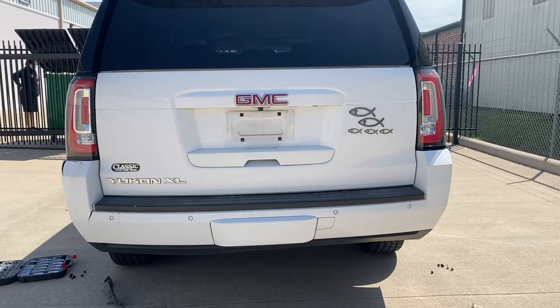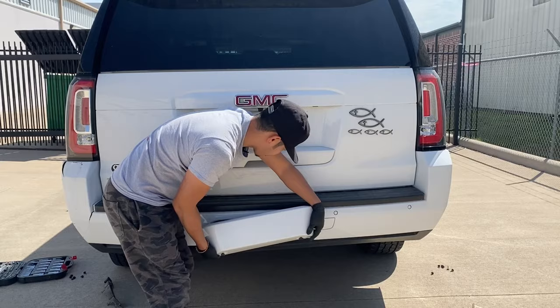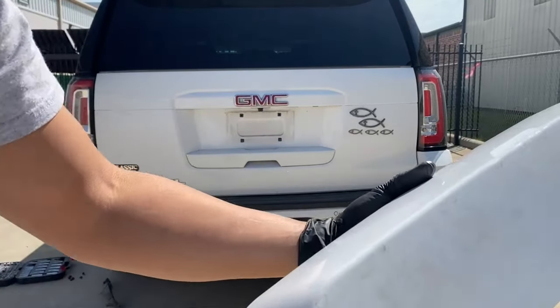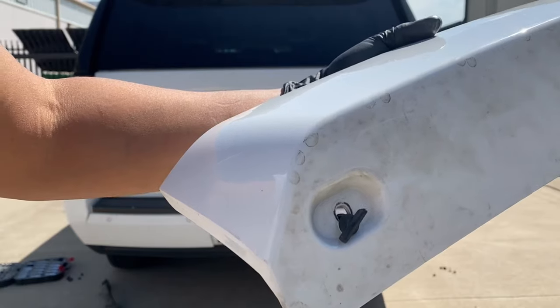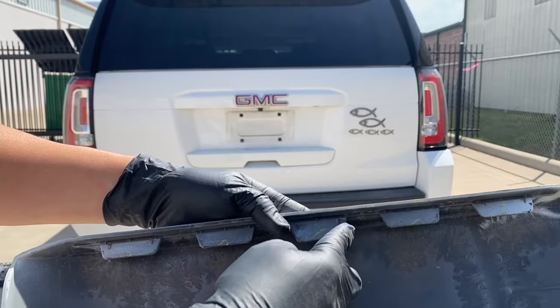So now we're ready to go ahead and pull off the bumper. But if you guys want to take off this cover — this hitch cover — there's going to be a plastic tab on the bottom that you just kind of unscrew off. So it's going to be these tabs right here; you kind of just unscrew them and tighten them back up when you want to put them on. Then you lift up because you want to get it off of these tabs right here.